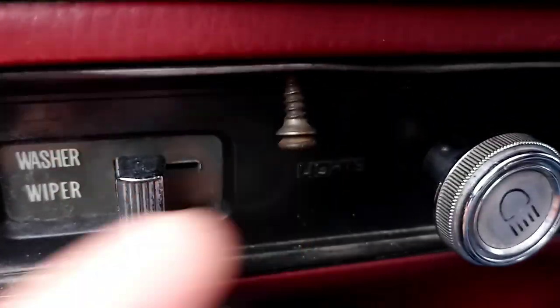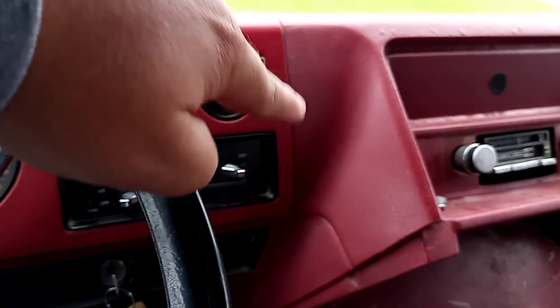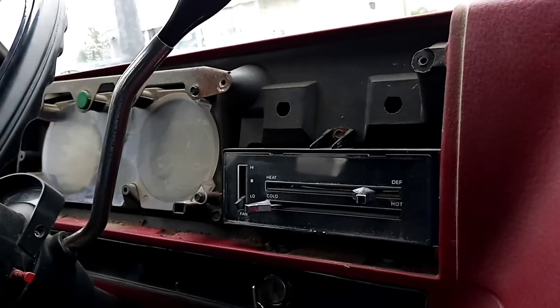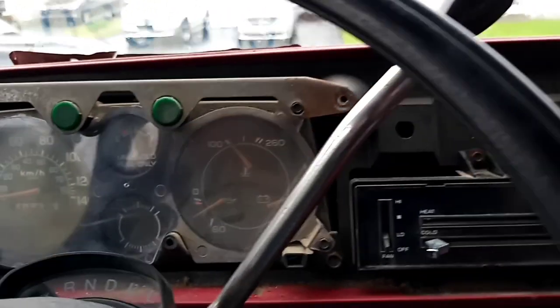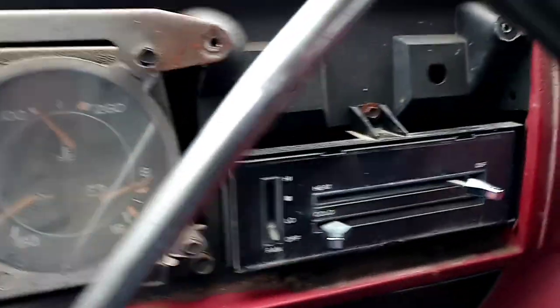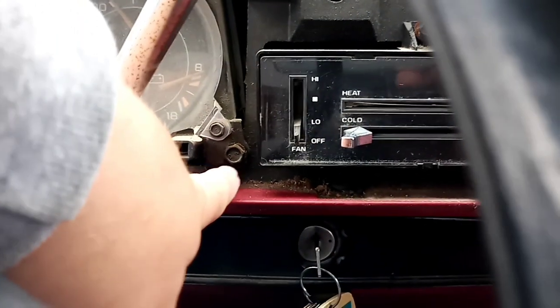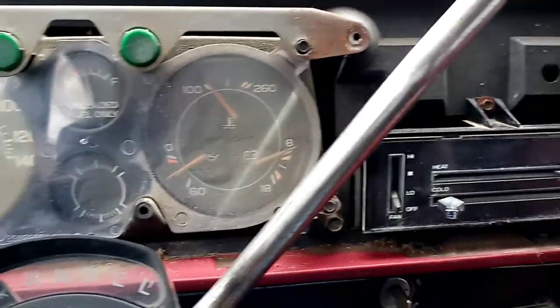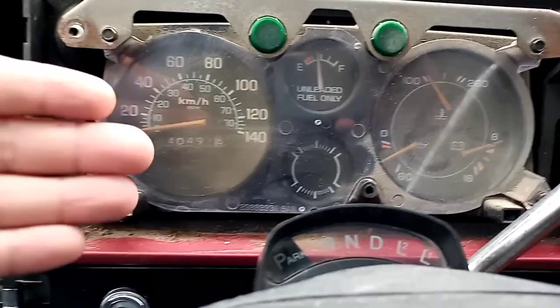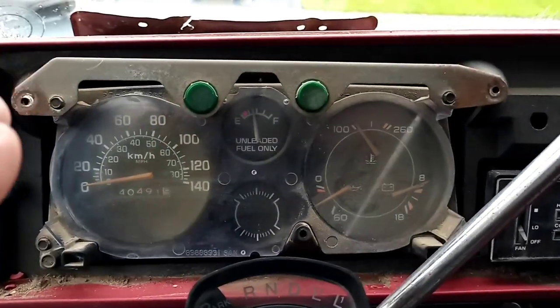By your light switch, between your light switch and your wiper switch, this screw is right there. So you take those bolts out and this whole casing — as you can see right here and around the edge — this whole piece comes off. After removing the faceplate, the only screws you have to take out are the ones shown here to completely remove the whole casing out of the dashboard.